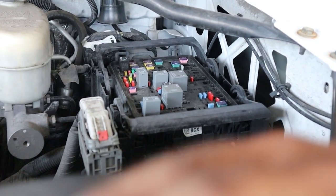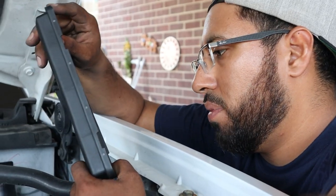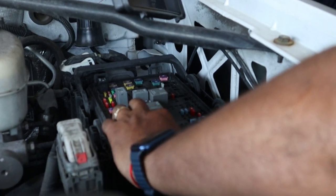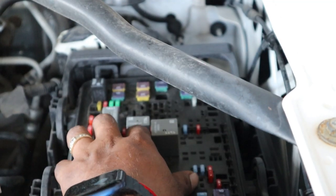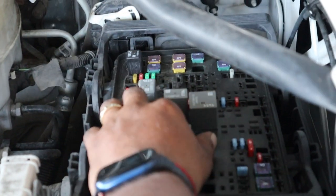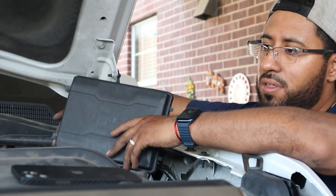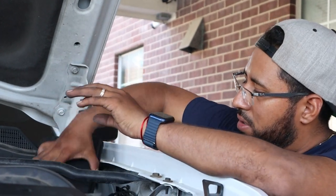Let me look for it — I hope this panel is the right one for our trucks, for the GM. If not, you guys look for fuse 39 on yours. When they did a service at GMC, they didn't put this panel on right, so I had to order a replacement. Fuse 39 looks like it's right here — right under the resistor. So you'll tap that fuse in there and that should keep your daytime running lights on whenever you have your automatic lights off. I'm going to look around for some wire. If I have it, I'll do it now; if not, I'll do it the day I do the HIDs. I'll close the hood and show you guys how they ended up coming out.